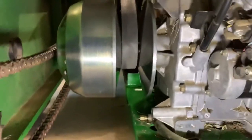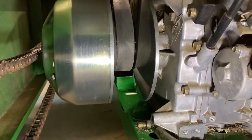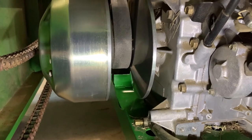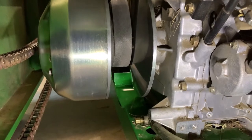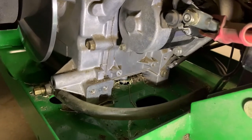Next I'm going to tighten the petcock valve back in. I tightened it up — I hand-tightened it because once I broke it loose and got it started backing out, I could back it out with my hand, which was good to make sure I didn't go too far. When I tightened it back up, I used my hand until I needed the wrench, then snugged it down. Make sure that discharge hose is picked up and tucked inside the chassis where it's not hanging out, otherwise you'll rip that off.